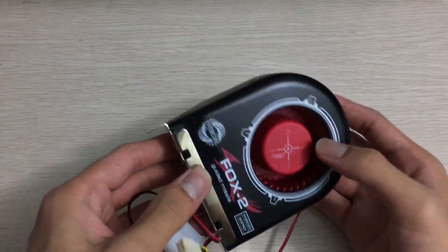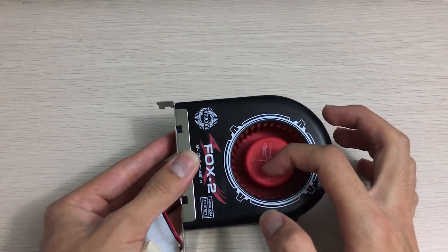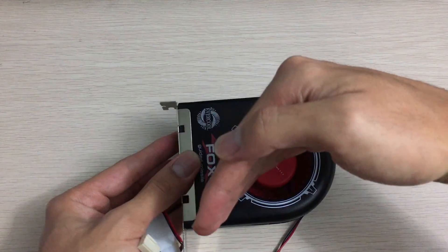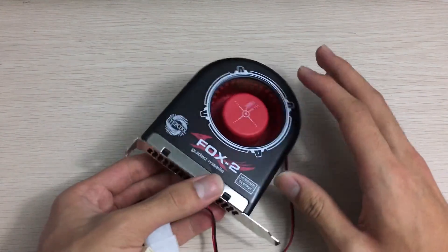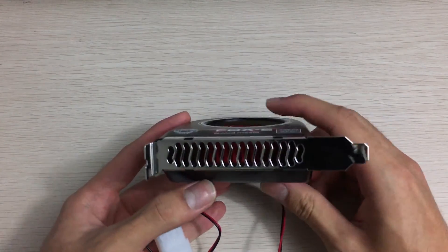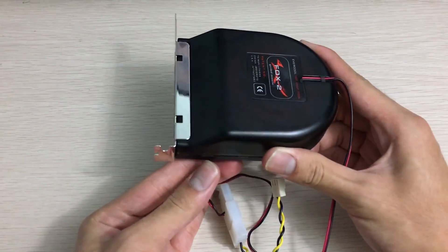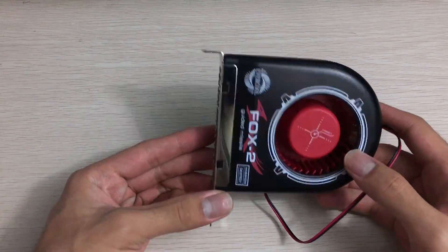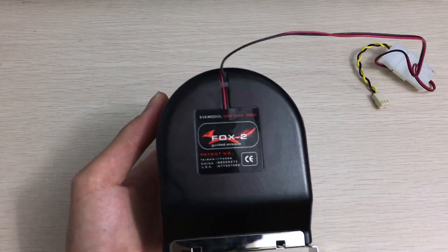Here's the product itself — it's a simple blower fan in a semi-transparent smoke black plastic housing, with a red impeller in the middle. It has backward curved blades, curved backwards relative to the rotation direction. Forward curved blades usually generate more static pressure but are noisier, so backward curved is what's typically used in graphics cards too. You can see it says 'Fox 2 Guided Missile Fan' by Ever Cool. Here's the PCIe slot bracket — simple ventilation like on a graphics card. You pretty much just slot it in, screw it in, and let it run. You can flip the bracket around too, which is handy.